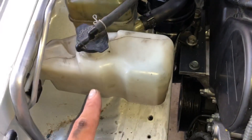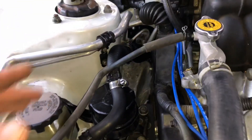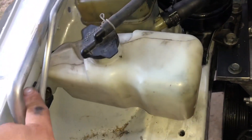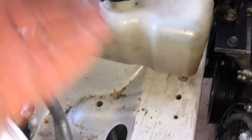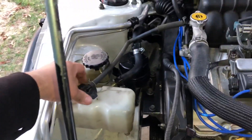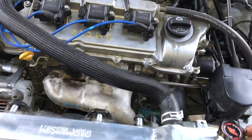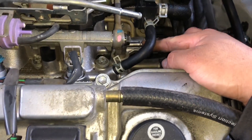Plumbing is complete. I was going to run the '97 Camry coolant reservoir — this gives an idea of where we want to locate it. Maybe put a rivet thread right here and build a little custom bracket so it can sit well. On the Mishimoto we'd just plug it up here, and for the throttle body coolant line we'd just run a hose from here to the throttle body — really simple.